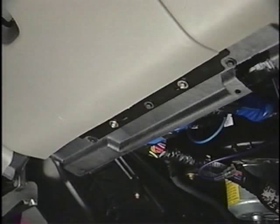If the hole in the carrier is broken, you can repair it with a small piece of sheet metal or a J-clip to form a new mounting hole. If that's not feasible for a good repair, you can also drill a new hole close to the broken one and use a sheet metal screw. Since the area is not visible to the occupants, it isn't really necessary to use a fastener that matches the original.